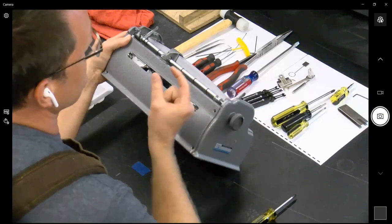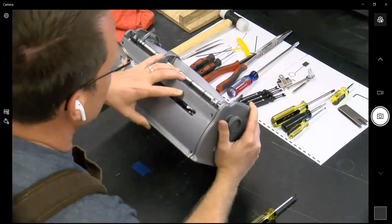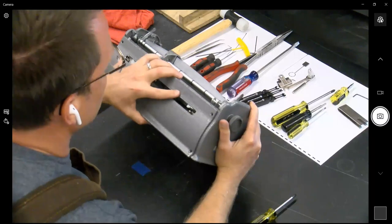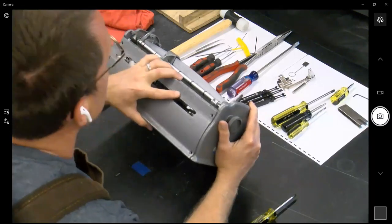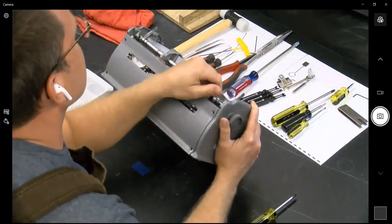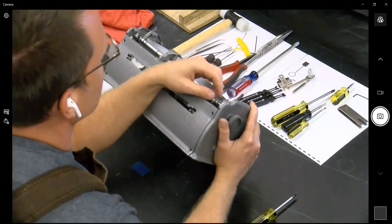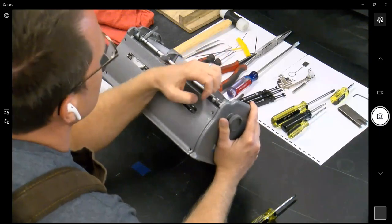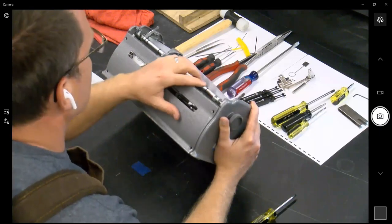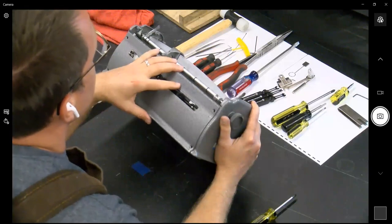There's a spring — a tab, just a straight spring that clips underneath the plate. When you remove the back plate, you'll see it flick up. When we go back through, we need to make sure that tab spring is caught underneath. Otherwise the paper check doesn't make that clicking sound. If you have issues with the paper check when you put it back together, go back and take the top plate off again, then loosen the back plate and make sure that spring is underneath.